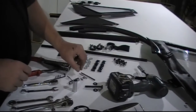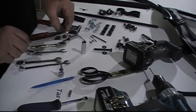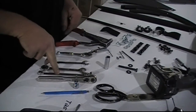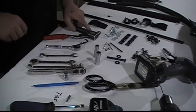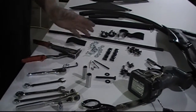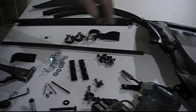The number 20 drill bit is for pop rivets. You'll need a T25 Torx head, a 13-millimeter socket and a 13-millimeter wrench, and then half-inch and 7-16ths sockets. Those are for a basic pop rivet gun. You'll need a 5-32nd Allen wrench. Velcro is in there. This is hardware to mount on the door for the window to mount to it.